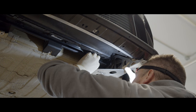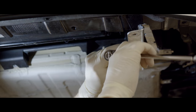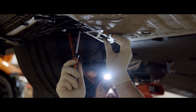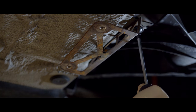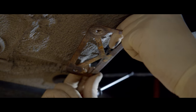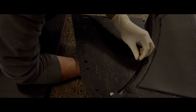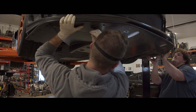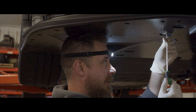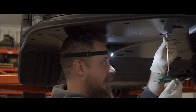The second thing the dive planes do is control and shape the airflow over the car. With aerodynamics, disturbed or dirty air is the enemy. The wheel and suspension assembly do a great job acting like an egg beater to the air flowing around them, creating a lot of dirty air. The dive planes serve to feed air up and over the front wheel, and they create a vortex, like a tornado, on the outer edge of the front wheel. Dual dive planes like ours create a stronger vortex. These vortices create a low pressure area along the front wheel arch to pull the turbulent air out of the wheel arch, further reducing lift and adding downforce.